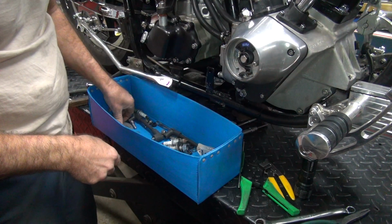Run them until they touch and back them off so we can move the plate. Okay. Should be somewhere in that area. Okay, we'll have to make sure we're on top dead center and then adjust this thing accordingly. Just hold it fully advanced and you rotate it to get in the right spot. Okay. Part's done. Let me get all this cleaned up. We'll be back.